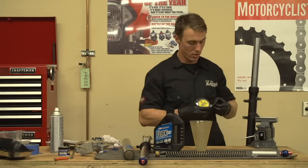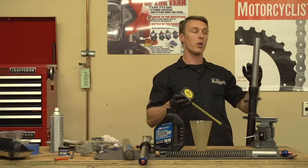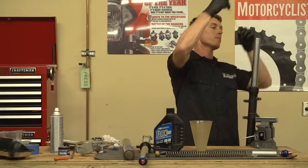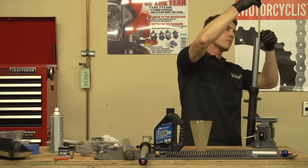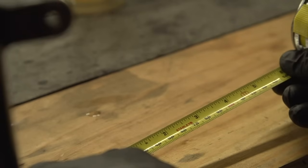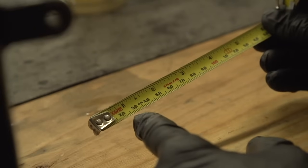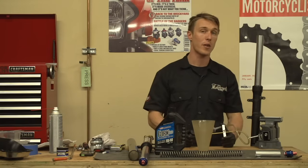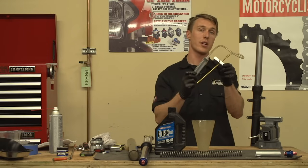To check the oil height, use a tape measure to verify the distance from the top of the oil to the top of the fork leg — this is a measurement you'll find in your shop manual. I set my finger at 150 millimeters from the top of the fork tube, and the oil is showing at 25 millimeters, giving us an oil height of 125 millimeters. If your fork oil is too high, you can either pour some oil out, hand-siphon it out with a hose, or make an oil height device — you set the rod to the desired oil height, stick it on the fork, and suck out the excess oil.